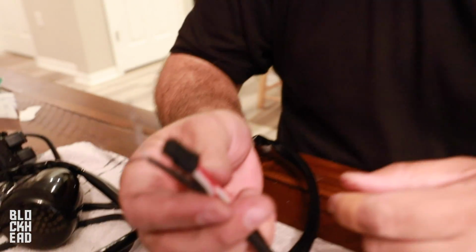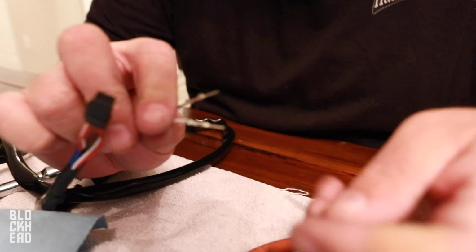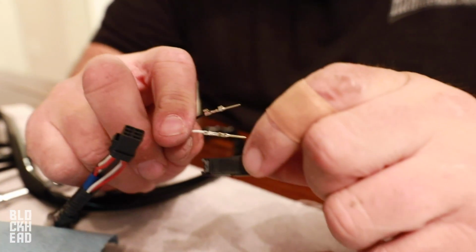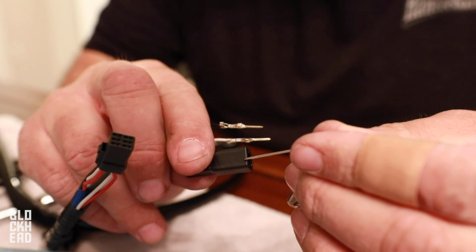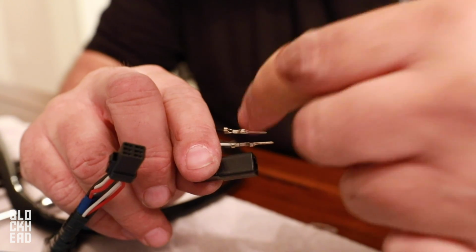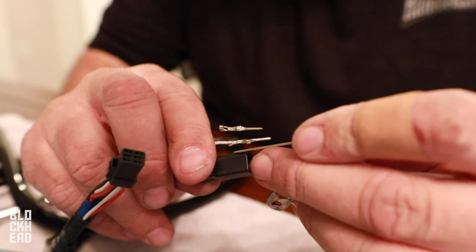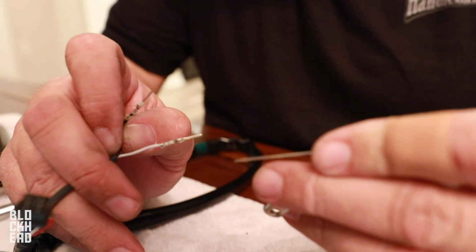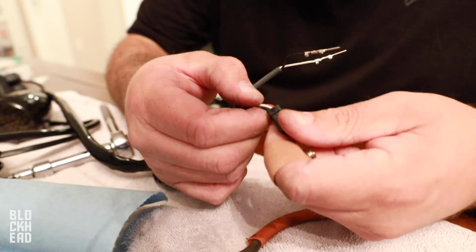And then I gotta do 6 on this one. You wanna explain the depinning process real quick? So pretty much, you got these little nut tabs here, right? And when this is slid in there, you kind of want to drag the pin across the top, and then you'll feel the pin kind of drop. And then it's like a little tab holding on here. So when you feel it drop, you push in and kind of pull up, and then pull the pin out. You've got to feel it.